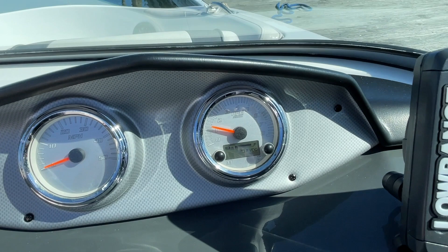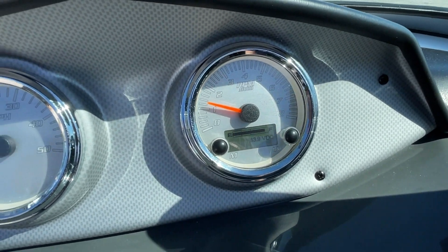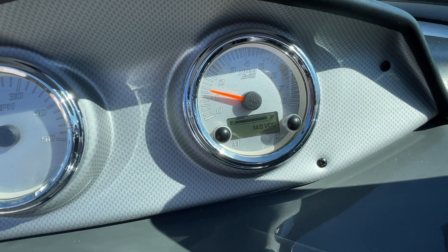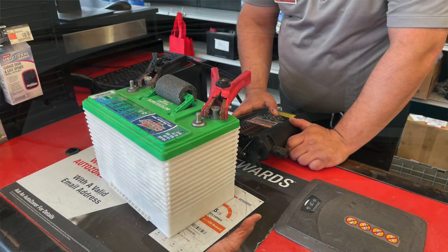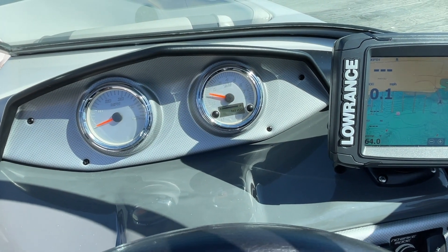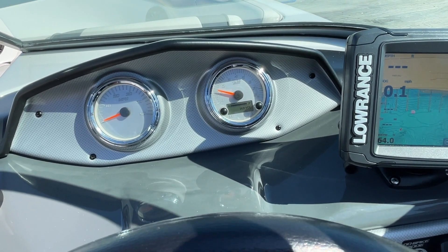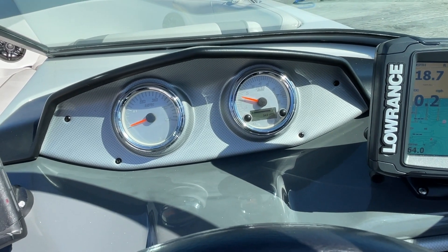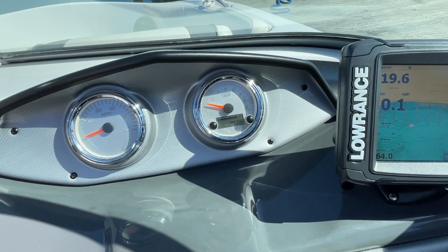This is lovely. All right, the bride says it's lovely. And we're looking at 14 volts right away. This is on the bad Interstate battery — I'm calling it bad — it's the older battery that gave us problems. Yet it seems like the charging system is working and the battery is charging. So what's the problem? Is it a bad cable? I don't know, but we will figure this out.